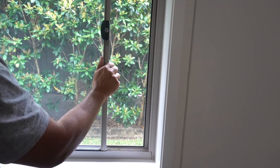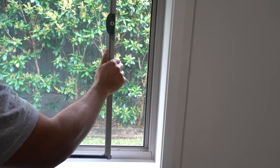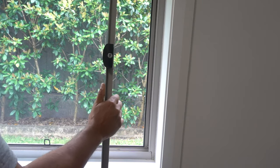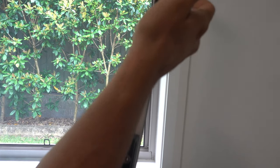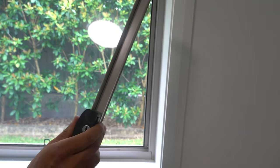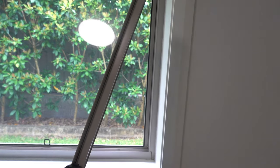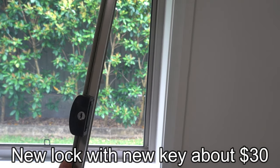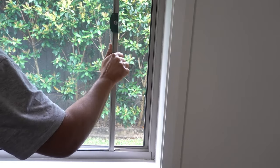Once you've done that you can remove your window — simply slide up, pull the window frame out, wiggle it out. These little locking mechanisms slide onto a little rail on the side, so just slide it all the way up or down until you get to the top of the channel and it'll slide right out, and you'll be able to replace it with a new one. I'm going to put this window back and show you a few different ways we can also go about this.